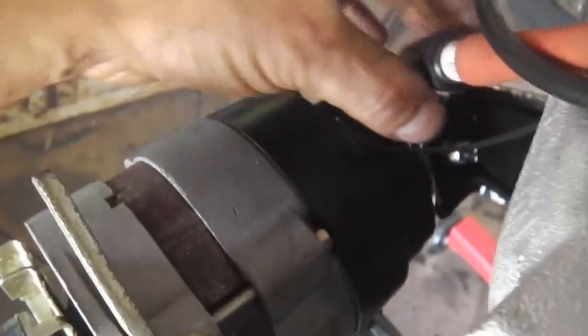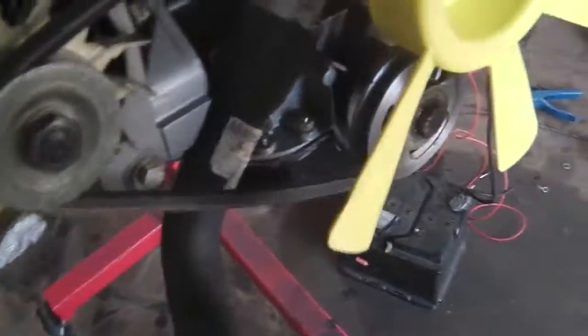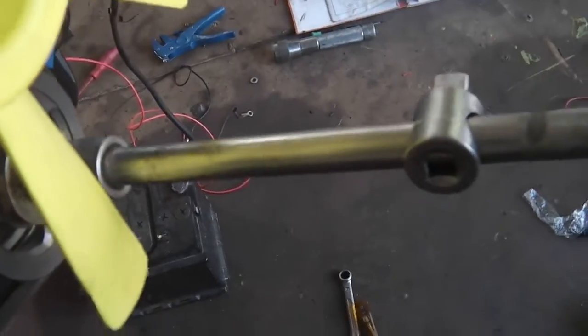So we'll drop the cap on. Lead one to plug 1. Stick that on there now and clip this down. Right, if I rotate it now, I should be able to go back. I think you can reverse these engines. I've got power on the battery. I think, yeah, I have. Right, so if you don't get this right, you're never going to start your engine up.